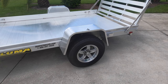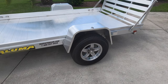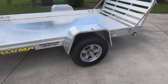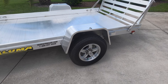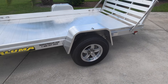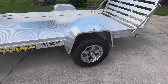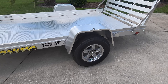Another must-have feature for me in purchasing a trailer was a torsion axle. For those not familiar, a torsion axle basically means the axle itself is encased in a hard rubber inside another tube, and the twisting action causes the cushioning instead of a leaf spring like you'd have on a typical trailer. In this particular case, this is a 3,500-pound rated torsion axle from Dexter — a super feature that also allows you to get the deck a little bit lower to the ground than if you were using leaf springs.